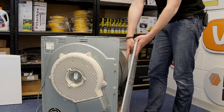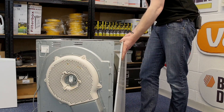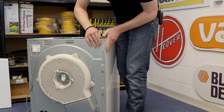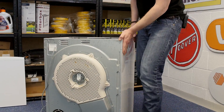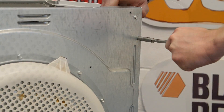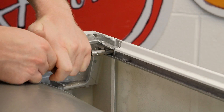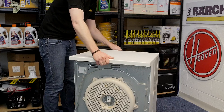To refit the side panel, make sure the pegs at the bottom are in place. Hold it firmly while you work the side peg in, and then you're free to screw it back together. All that's left is to replace the top of the dryer.